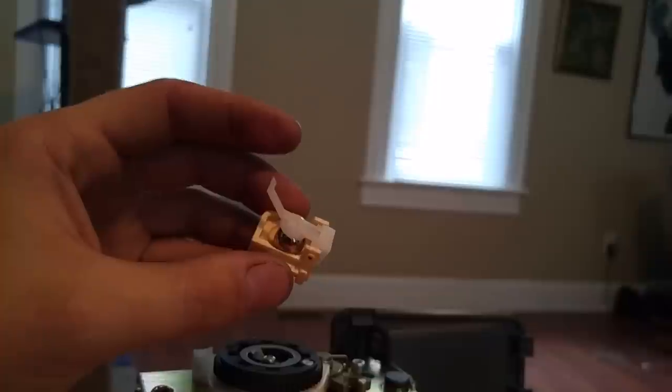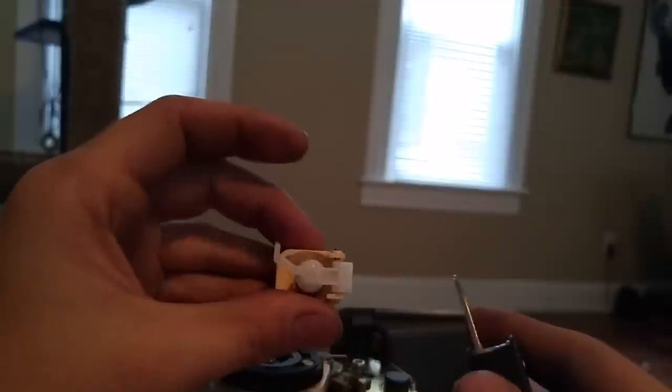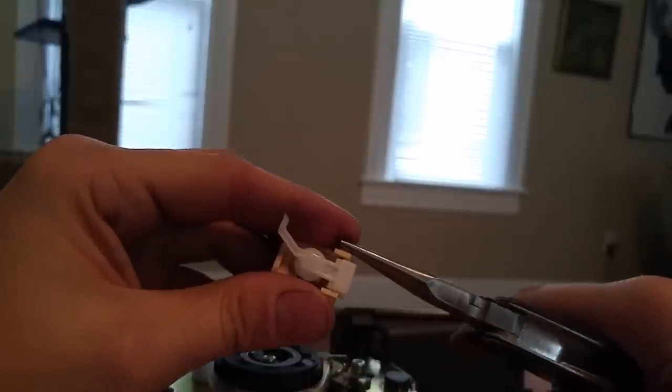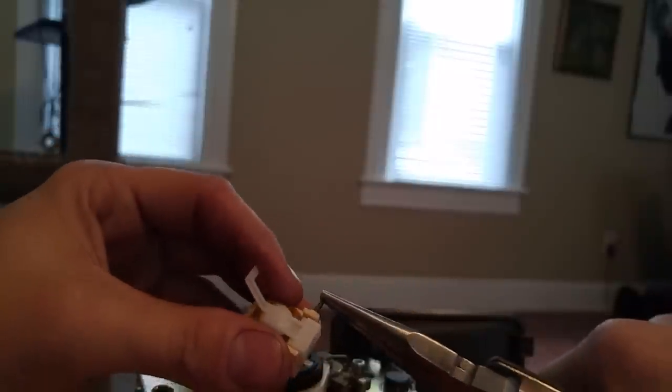I've already taken this apart to figure it out. When I bought the vehicle, the previous owner did say it sat for a while, and so there was a bunch of grime in here. To clean it out thoroughly, I found the small end will push that pin out slightly — see, that's enough to grab it. Pull out this pin and now it's just three easy pieces. There was some grime in there — I'd clean that out. It's a pretty easy, quick fix that I couldn't find anywhere else online.